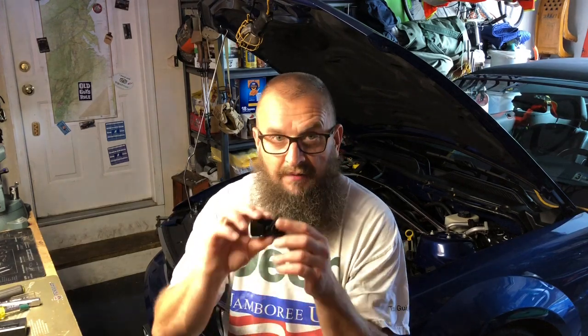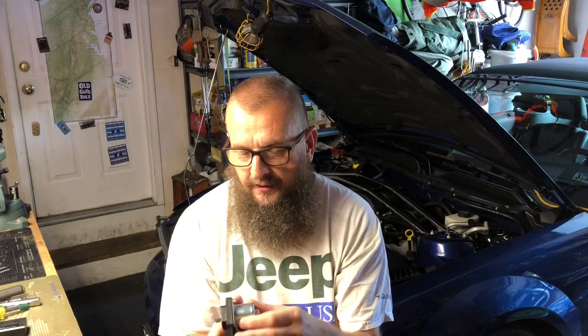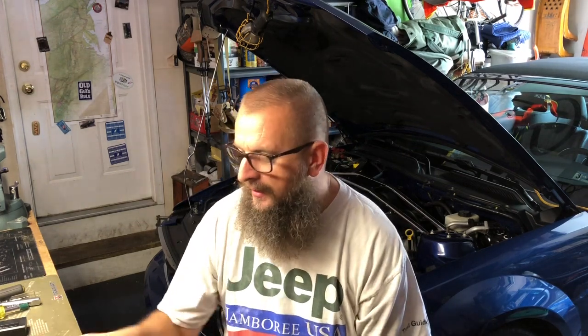On the other side of the throttle body there's a throttle position sensor. When I had the original one apart I had this motor pulled off the bracket — inside are the brushes and motor windings. My original thought was I probably didn't get the motor back together correctly, so I went and bought a replacement and replaced it. It didn't work, didn't fix my issue.